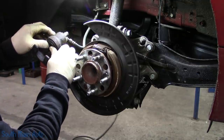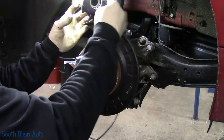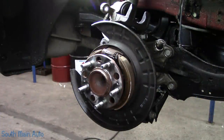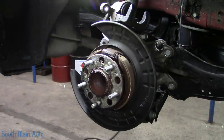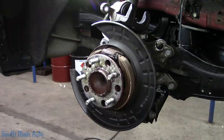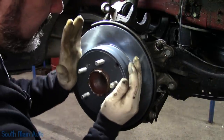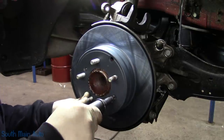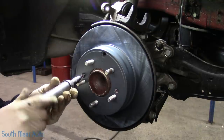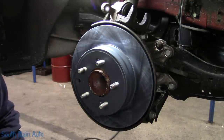That looks good. I don't know if we can push the piston in by hand — yep, we can. So the piston's all the way in. A little bit of air behind the boot — we'll let her sit; sometimes that will come out on its own. We'll go get the bracket ready. Before we do that we can put our rotor back on — a little fluid film coat there to keep her from getting crusty. We'll grab our brand new rotor and line up our screw holes. Parking brake's not hitting. We'll grab our screws — don't go full gorilla on these; they don't have to be that tight. They're snug, and if you had to drill yours out or chisel them off, forget about it — you don't even need them.